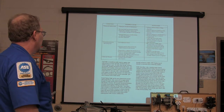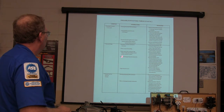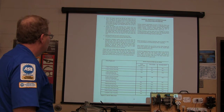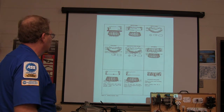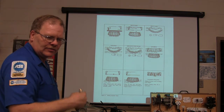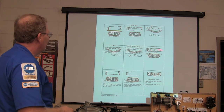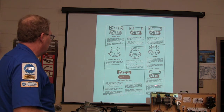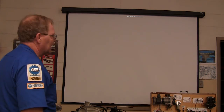You've got a lot of stuff you can look at right here — that's a pretty good little handout. You've also got a troubleshooting table for worn or damaged components. You've got to make sure that you've got the fluid checked. Always check the fluid. You've got service shims that you're going to use to get the clearances right and the preload right on the bearings. The ones that are cone-shaped you've got to preload. This gives you a bunch of illustrations of what bearings look like when they're messed up — stained discoloration from incorrect lubricant or moisture, frettage, smears, abrasive roller wear and that kind of thing. And that's the end of the slide deck.